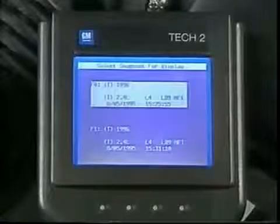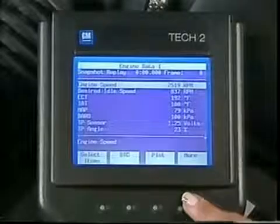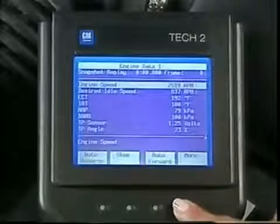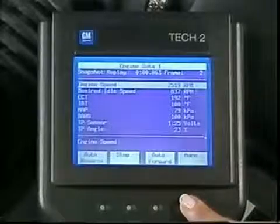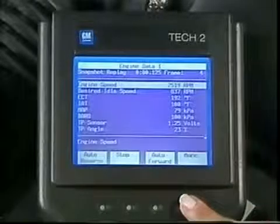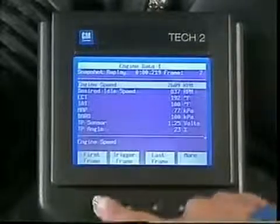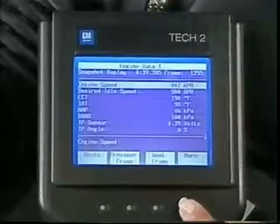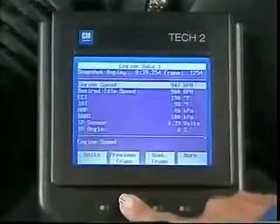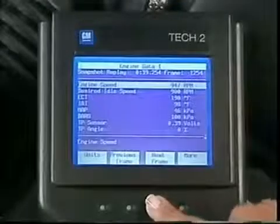In Snapshot Replay, there is a wide selection of soft keys to help you save time. By pressing More, you can go directly to Auto Reverse and Auto Forward to view the snapshot frames one after another in succession. By hitting the More key again, you can go directly to the first frame or last frame. And by hitting the More key yet again, you come to Previous Frame and Next Frame, which will allow you to move the snapshot display one frame at a time.